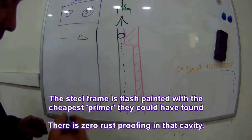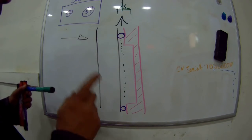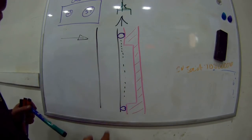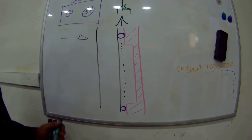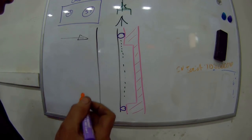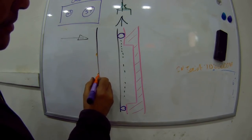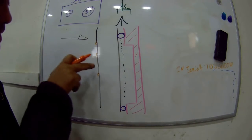What happens next is really interesting. The corrosion will start through an electrolytic reaction. I don't know what the name is, but this is aluminium, this is steel, this is water. If you get a salty environment, this is even worse. It's like cancer for a car. Over time, you will see a little blister like this. You'll see little blisters all over the top. And I'll go outside and show you. You get little blisters. This is on the outside.